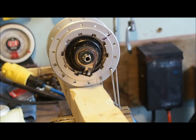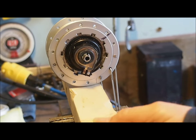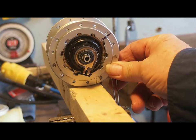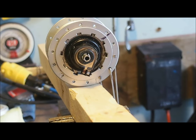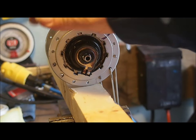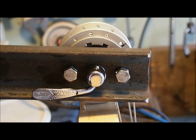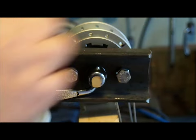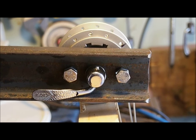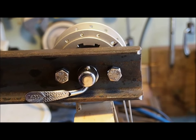What I'm going to try here is something I've done with Sturmey-Archer hubs — getting the ball ring out of a hub that's out of a wheel. I've got three spokes threaded into the spoke holes and clamped tightly in the vise, with the hub shell braced on the top of the vise with a piece of wood. I've got the tool clamped in there with a QR skewer, with the bolts engaged with the notches in the shell.